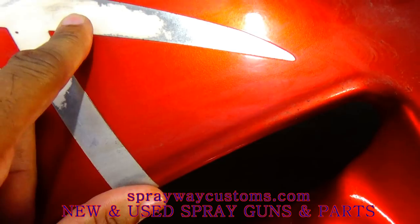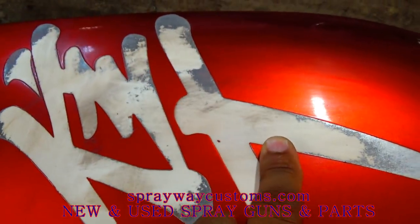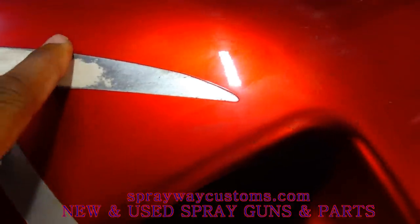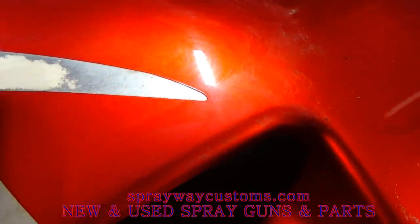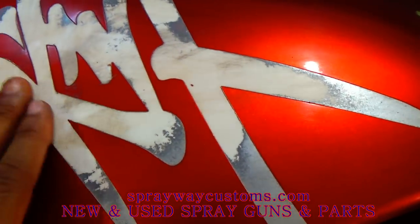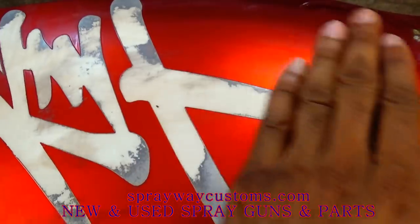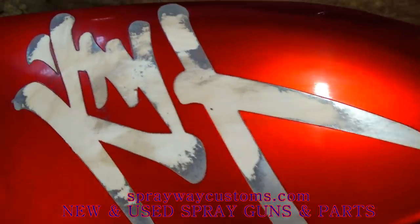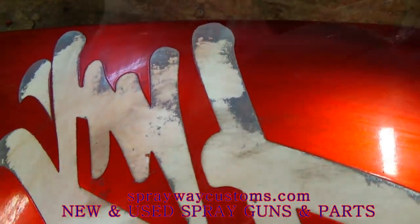So what's next? I'm gonna get my DA with some 320 and I'm gonna get this paint line up, because you can feel it. You don't want to be able to feel anything when you run your hand across, because if you do, you're gonna see it in your paint. So let's get that started.